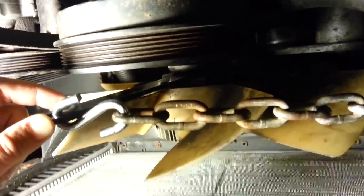Still, it didn't want to come loose very well. To keep it stationary, I put a chain on it and ran the chain up and over the frame rail, dropped it down, and put another little hook on it so it wasn't going anywhere at all. After I did that, I was able to get plenty of leverage with the other wrench — I could stick it up in here and really lay the torque onto it and break the nut free. Hopefully this additional information may help you out, even though I'm trying to explain this upside down.